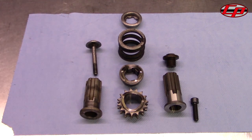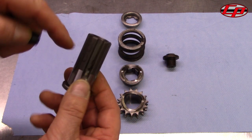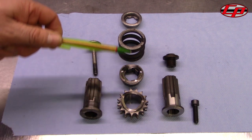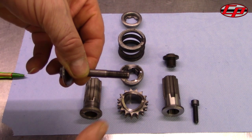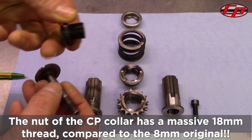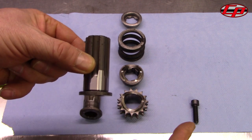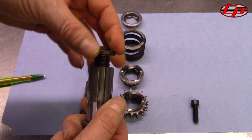The CAS performance version again uses an 8 millimetre bolt but it's much shorter. Internally, the collar has a positive stop, so when the bolt goes down through and is screwed down it holds the collar in place. With the standard version, you have all these components pushing up against this long bolt with a simple 8 millimetre thread. The CAS performance version instead has an 18 millimetre thread. The collar for the CAS performance sleeve is threaded at the end, so once fitted in place with the Allen screw, the components go down over the top and then this massive thread holds everything in place.